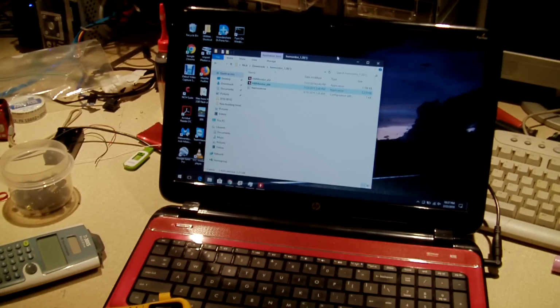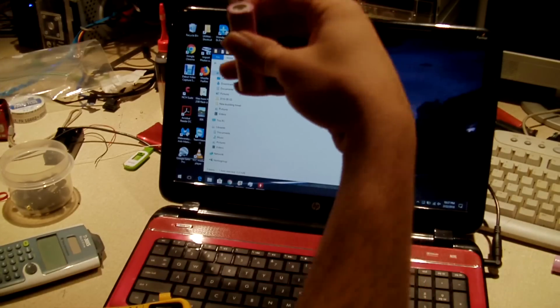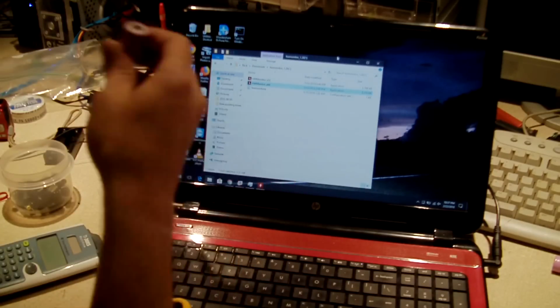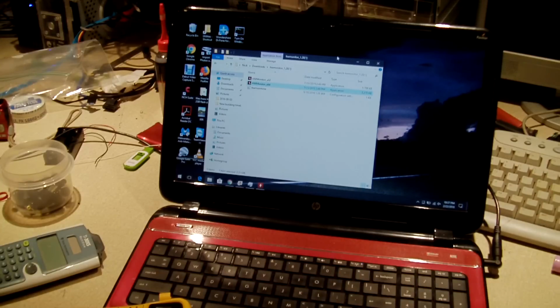So, as mentioned, the one with the barcode apparently had the lowest capacity out of the rest of them. And of course, with lithium-ion packs, you're going to be running at the capacity of the weakest cell. Whenever the first cell gets below the termination voltage, that's when it says that your battery is dead. That's why with laptop packs, the whole battery is deemed dead and needs to be replaced when just one cell goes bad, or one set of paralleled cells goes bad. Usually when they're paralleled, the ones that are hooked in parallel together will go bad.